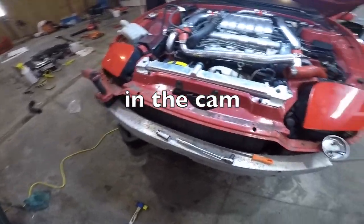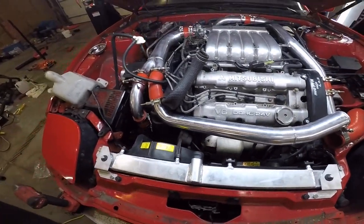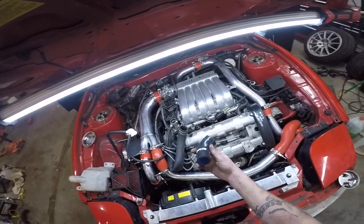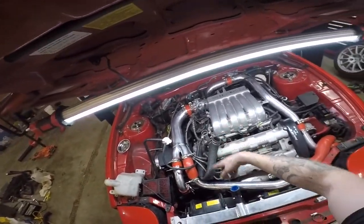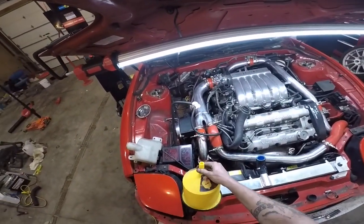Alright, the battery died - I got it. You can see the gap over here. Got all the wires plugged back in, just gotta put the hoses on and that's pretty much it. Something needs to go that way for me to fit the overflow tank. This is a little trick I do - I always have this piece of hose that I've kept for I don't even know how long, no matter what car I work on, just so you can fill it up faster. Right here you can at least fill up the radiator, plug that in, and then put the little pressure bleeder on there.